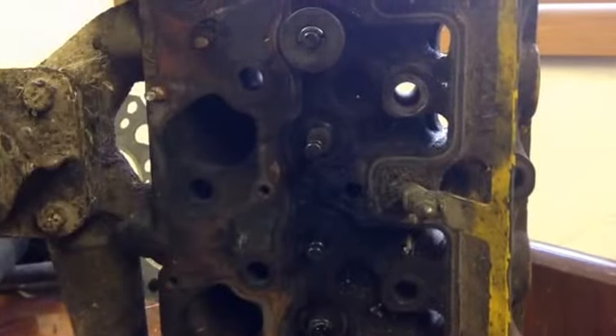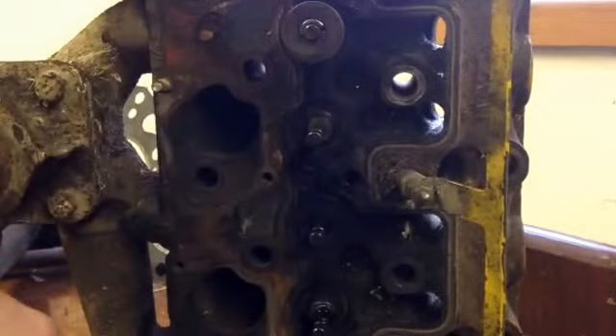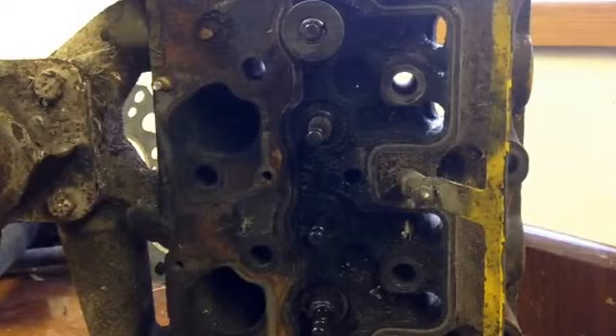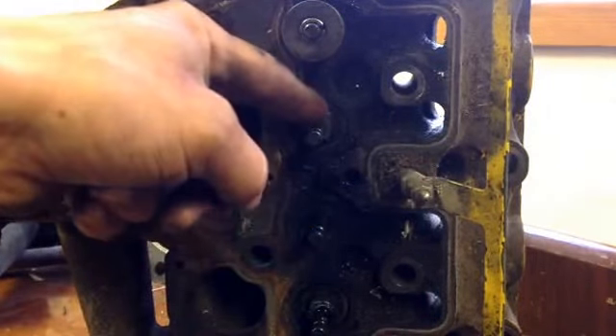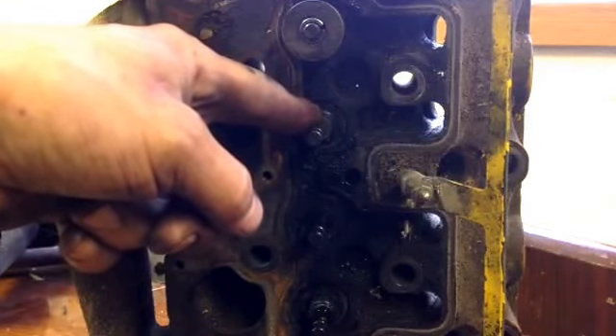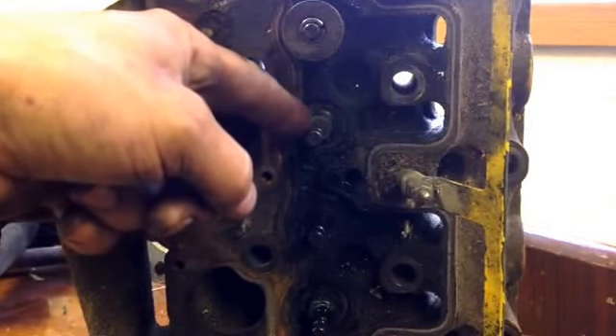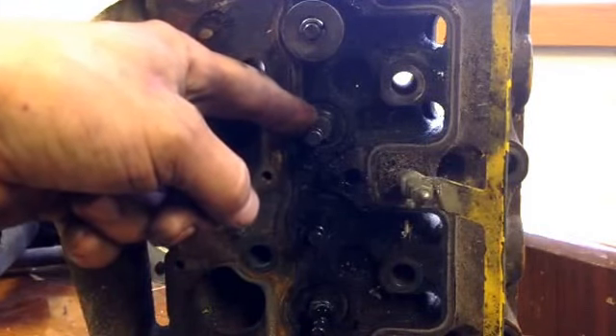You lap with your coarse first and always finish off with your fine. Most people are going to say that doing this much grinding is going to ruin your valve guides. But those valve guides are really easy to change if you can purchase them for your particular engine — all you've got to do is tap them out and then tap a new set back in.